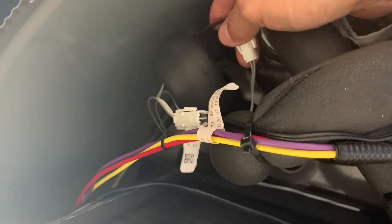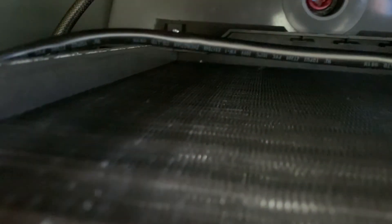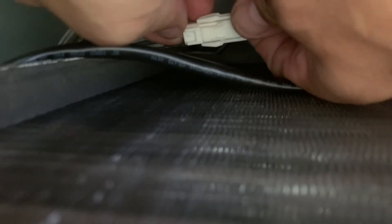The upper sensor in the hybrid unit has the plug right here and the sensor itself sits down in that tray. Disconnect the clip and gently reach down to pop it out. To reinstall, carefully push it right back down in between the tabs on the condensation tray, then reconnect your wire. It's that easy.